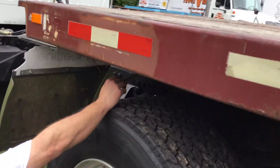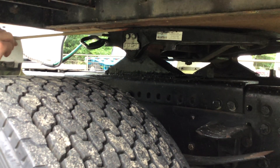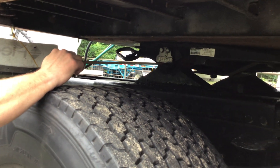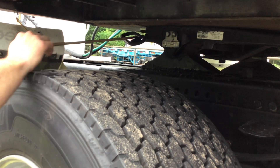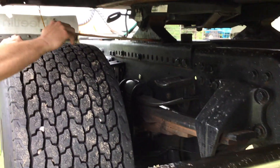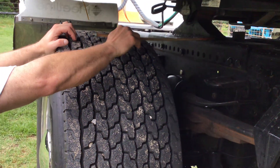We'll talk about the coupling system. My apron is properly mounted and secured. It's not cracked, bent, or broken. It's sitting on my fifth wheel skid plate. My skid plate is properly greased. It shows no signs of daylight or gaps. It's not cracked, bent, or broken. It's secured to my platform with pivot pins. My pivot pins are not cracked, bent, or broken, and are properly greased. My release arm handle is in the locked position — it's not cracked, bent, or broken. My safety latch is present. My locking jaws are in the locked position around the kingpin shank. The kingpin shank is not cracked, bent, or broken. My platform is properly mounted and secured. All platform mounting bolts are present and tight. It's not cracked, bent, or broken. This is a stationary fifth wheel — no air slide.